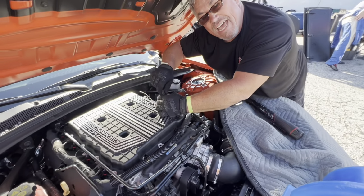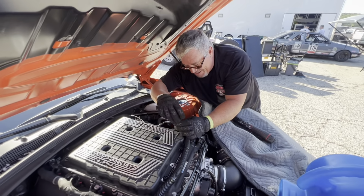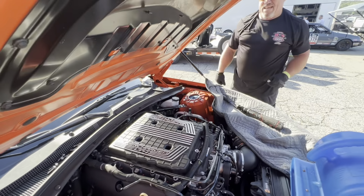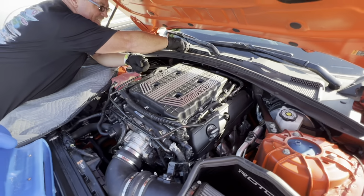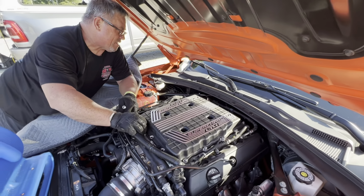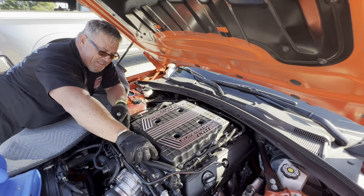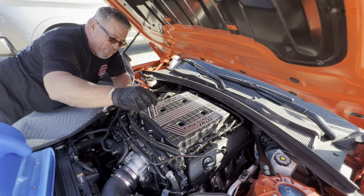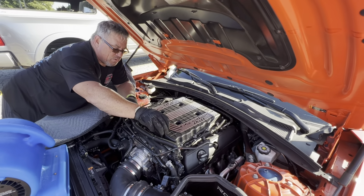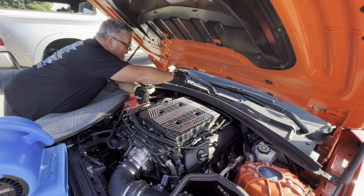Now you're going to go for that 129 today. Yeah, the plate's going to make some difference. I thought about doing it, but I didn't even think about the heat soak. I saw the videos about doing it for noise, and then I was like, metal on aluminum inside of a plate. I talked to some people at Late Model Performance in Texas, and all the drag racers take them out, because between the rounds it goes right up, and that's just not a good place for it.